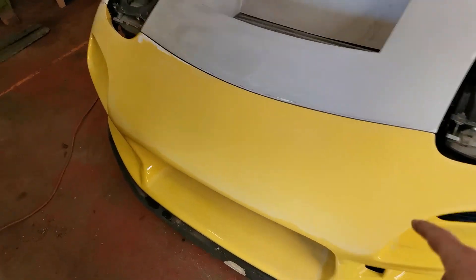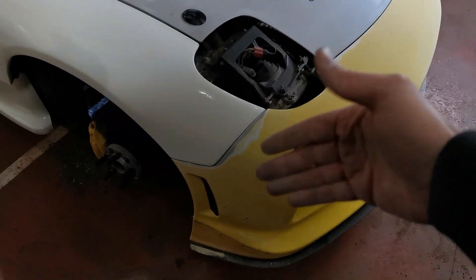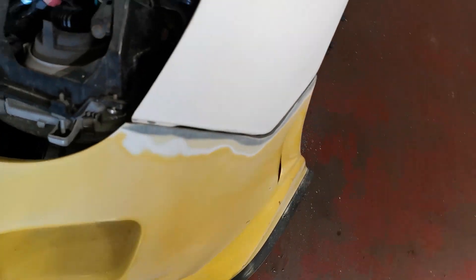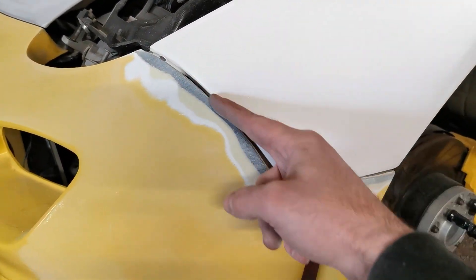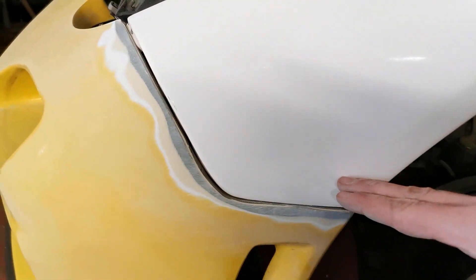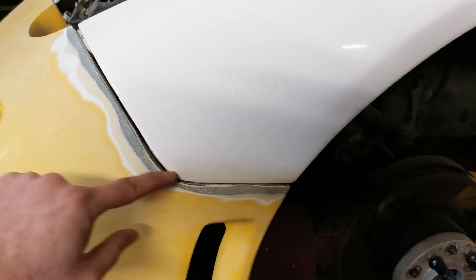So we're doing a bit of sanding. The front gap is pretty decent — probably won't have to put any filler on that one. We're going to concentrate on where the wing meets the bumper. It's come out alright, but that's about as much as I want to take off from the bumper side. This side has got a little bit of a gap, so what we're going to do is flush that gap with some body filler, then I'll take a Stanley knife and when it's at a rubbery stage cut that line so it doesn't join together. All we're trying to do is get the panels aligned — take up that little tiny gap, flush it, then take the bumper off at a later point and sand the flat edges so there's a nice tidy gap.